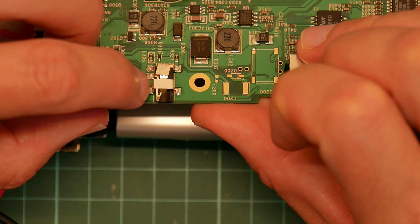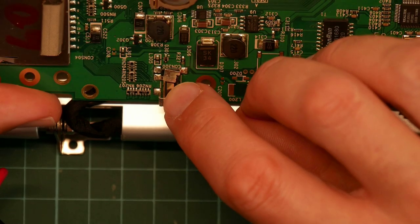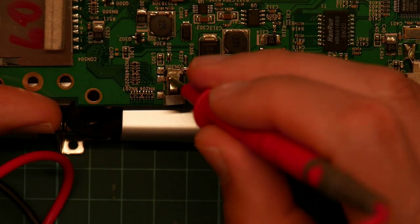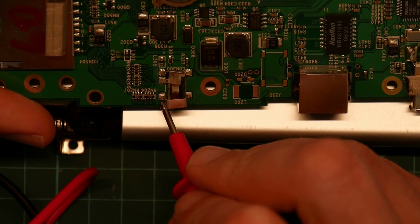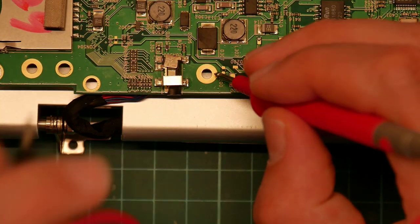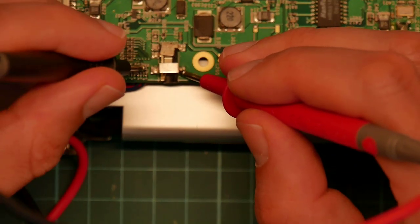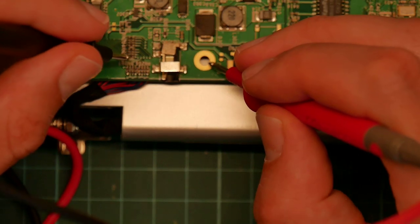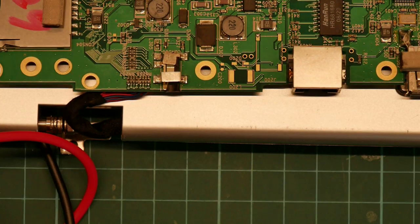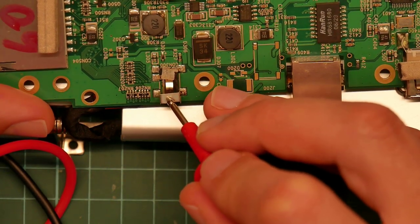The biggest question is going to be how to stick this down, given that the solder pad has failed. This is grounding plane, this stuff, so there is copper under there. But it's not actually connected, which I don't think it's connected. Yeah. It's not connected to this. These two planes are connected, which is a good thing. So I may be able to scrape away some of the solder mask from here and then use that as an anchor for this thing.